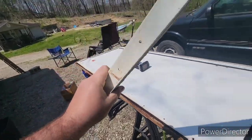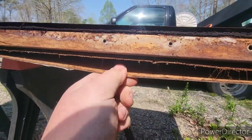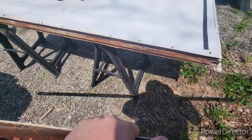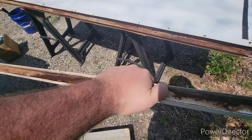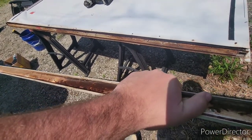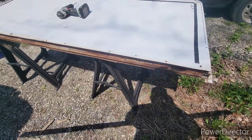The main reason I'm taking this off is because this channel lays like this on there, and that front piece of cladding for the front lip's outer layer was actually out of this lip on the channel. In order to make sure it was sealed good and didn't leak anymore, I had to take this off on this one. The front one didn't ever come out of the channel so I was able to put enough glue in it to hold it, but this one I had to take apart to get it back in the channel properly.